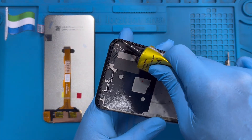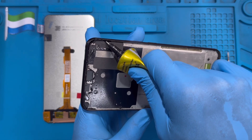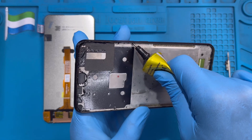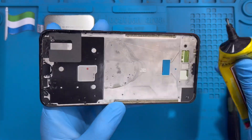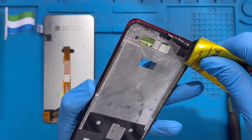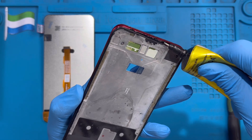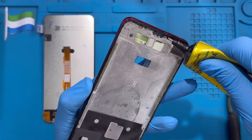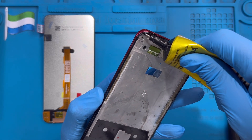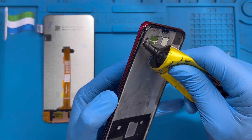Sometimes when you try to open the old LCD, this rubber seal will come out. Make sure you put glue under the rubber also — the rubber also needs to be secured before the LCD is fixed. Put the glue right underneath first, like this. Anywhere you see the rubber has come out, put glue underneath it first before putting glue on top, so the LCD can rest properly.